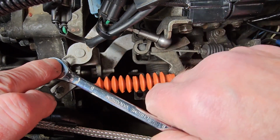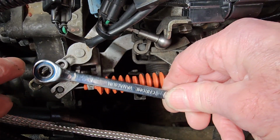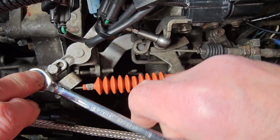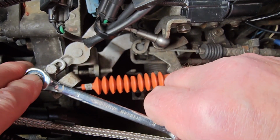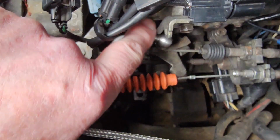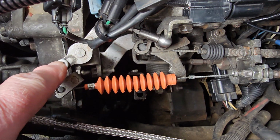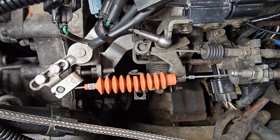But like I say, in the earlier bit, it probably needs tweaking, simply because of the age of the car and the number of miles it has done. Tighten those up, and now that has got full throttle open with my new bracket here, my new bearing there, all the slack is taken out, so this should go back in and out smoothly, and hopefully I will get better gear changes.